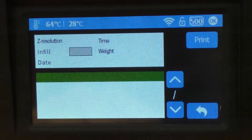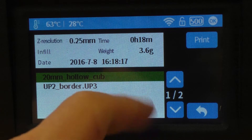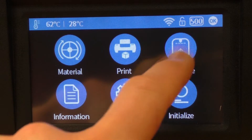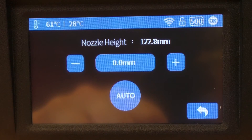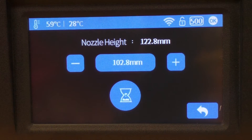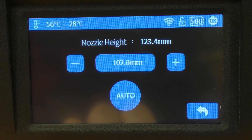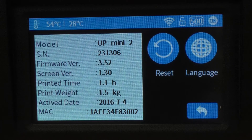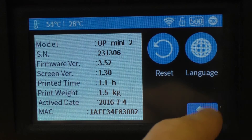Going back, we've also got Print, which will show previous prints — up to 10 prints can be stored at a time. Then there's Calibrate. To calibrate your printer, just hit Auto and it will set its nozzle height. This is something you'll need to do when you first set up the printer — in fact you should do it before installing the filament, because if the nozzle is too hot the printer will come up with an error message and won't allow you to do it. Ours has been set at 123.4 millimeters, which is how far the platform needs to move up for it to start printing.